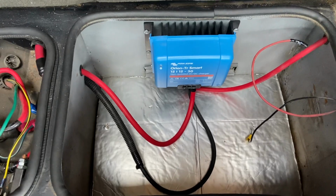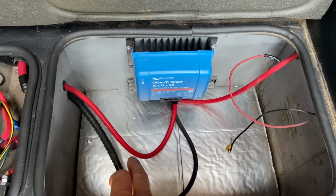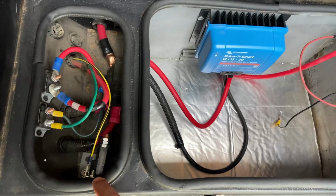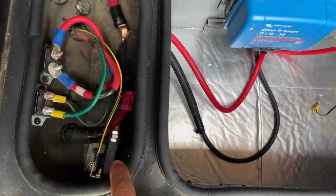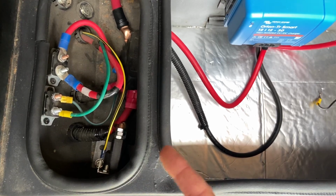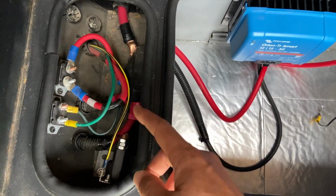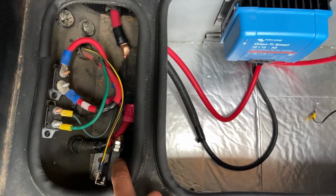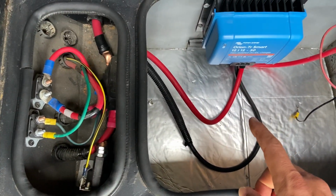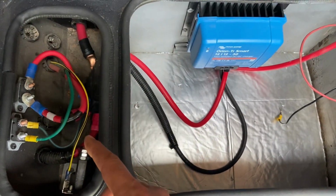Since this was the battery box before, what we had in here was a ground wire coming in and a power feed coming in from the batteries to my electrical unit over here. With a little bit of research, I was able to find out what the different items were in here. Down over here was my system that connected the motor home to the house batteries when you started the RV. Once you started the RV, this connection was made complete, and then it fed power into the unit. All we did was take this out of the equation because the DC-to-DC charger does that for us now. So now the power comes into the box, goes to the DC-to-DC converter, and then comes out of the box and up to the bank system.